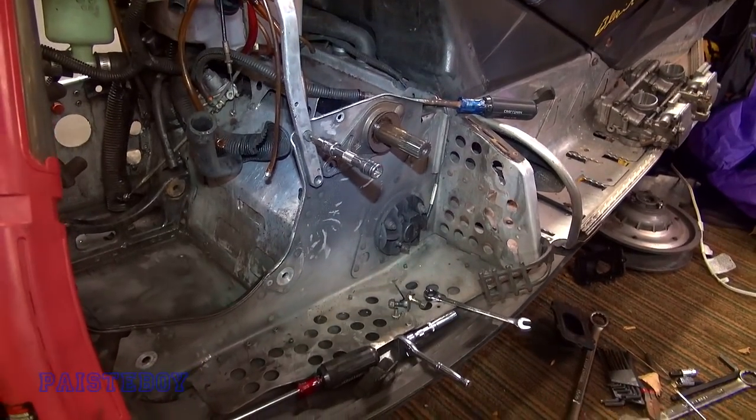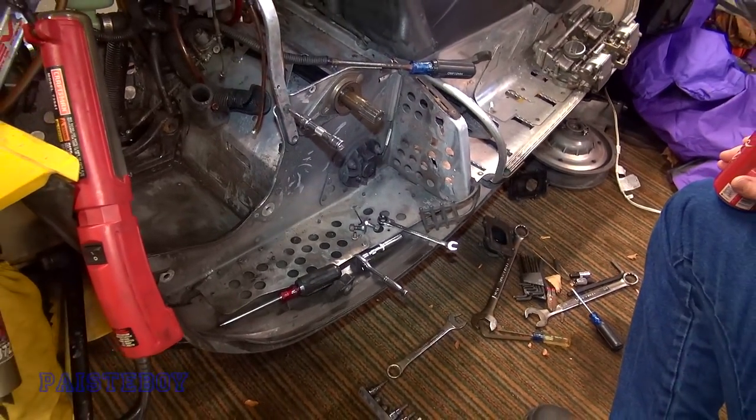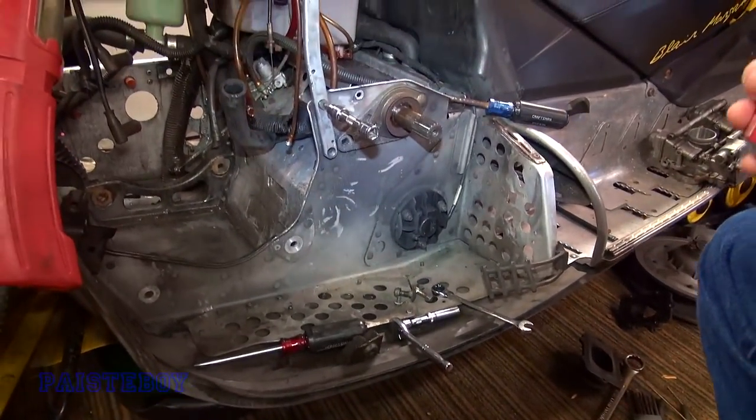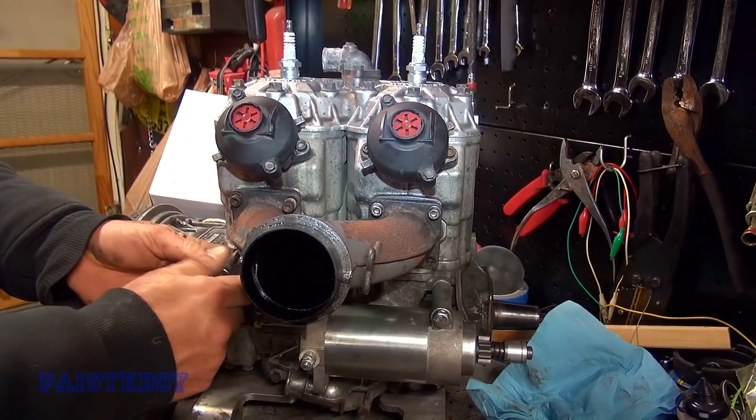So what do you suggest? Grease up. The drive shaft bearing should be greased right there, and I'd probably check it underneath to see if there's any play in it. Good idea. He's probably never greased it. This zerk is probably clogged — the grease fitting for the drive shaft. A little grease. Red Loctite — they're notorious for falling out.